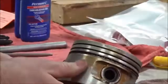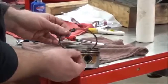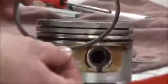That oil ring installed correct? Absolutely. So I'll go ahead and just finish off these other couple of rings here. What you're going to see is we got our dot. This is the black ring, or the second one. That's going to face up.